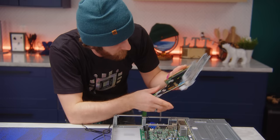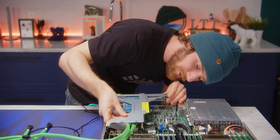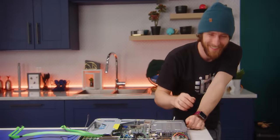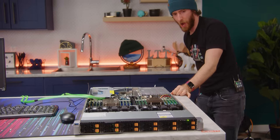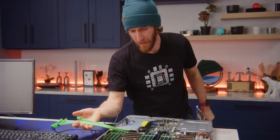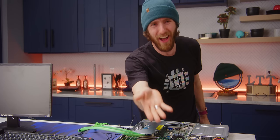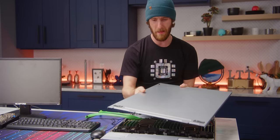So here we go, we just install our Gen 4 tri-mode card into our caddy here and plonk that into our server. Oh, contact! Believe it or not, we haven't even turned it on yet. There it is. Here we go. You ready? Now, one little trick is normally you would run these cables internally to the backplane at the front of the device, obviously, right? Well, that's not a tri-mode U.3 backplane, so we're just gonna kinda...